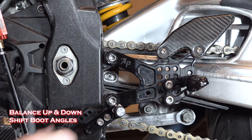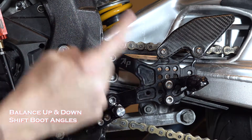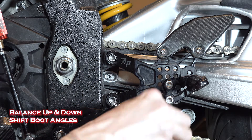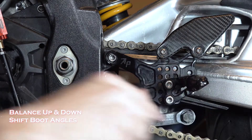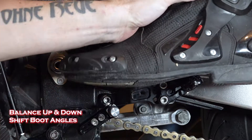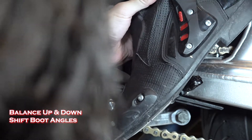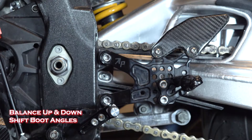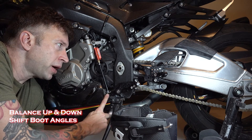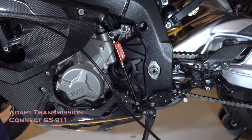We can move this peg down and get a little bit more even, which will give us a better angle. I've taken that peg and moved it down to the lowest position it can go — it'll be one notch lower than the other side right now. I don't want to move the other side because then I'd get my boot closer to the exhaust and might burn it. So I'm just going to move this down and leave it in the middle for now — I can always move it back later. Now I put my boot on here and it still looks good. Going to upshift, I feel like I've got a better angle on it than before. I've got these two angles as close to 90 degrees as I can, a little bit more moment arm by moving that out a notch, and this down a notch to give myself a better boot angle for upshift and downshift.